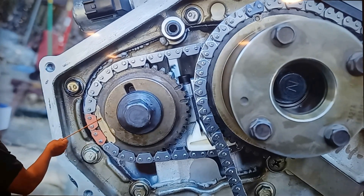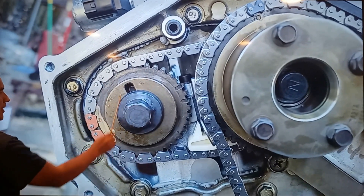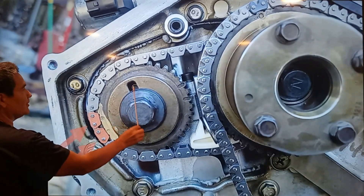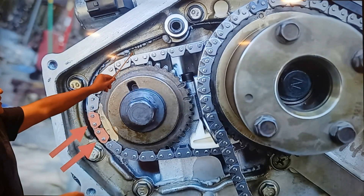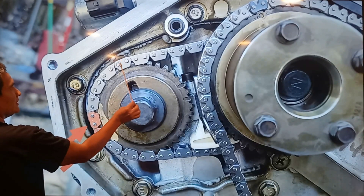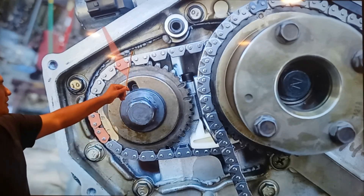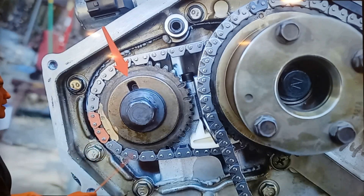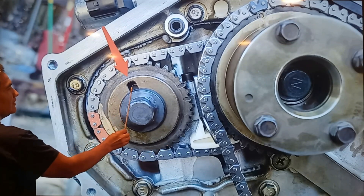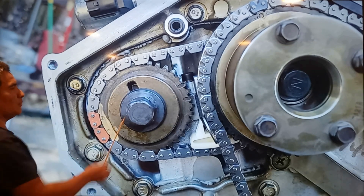You can see the timing mark lining up with the highlighted links here, and the secondary timing chain bracket. The question I always get asked is: why does this hole not line up with the timing mark? It would seem like it should line up right here. This one is lining up with this link on the timing chain. Don't worry — this one never lines up. Some subscribers say every time they go to YouTube, everybody says this hole has to line up with this timing mark.